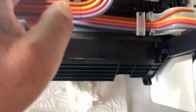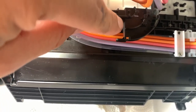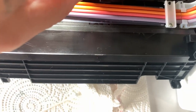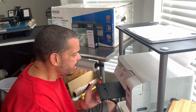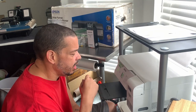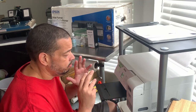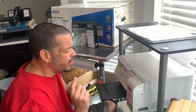Remember the line from the factory — make sure it's level with this, so just put it here like this. As you can see, it's level. Then start clipping them in. I turned on the printer again and it says the printhead may require maintenance because the printer was not turned off correctly. We're just gonna hit enter. So far I'm not getting any codes, which is beautiful. Before I do a nozzle check, I think I'm gonna do a purge first.